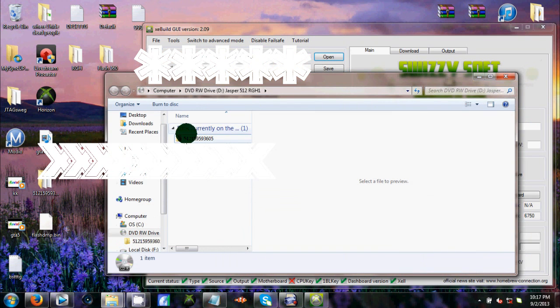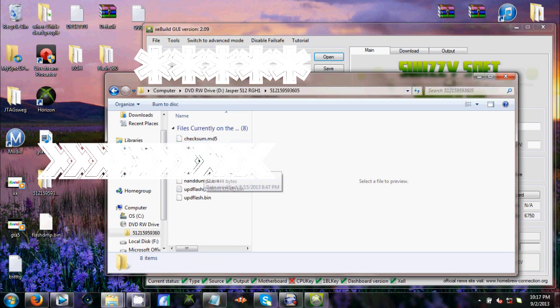If you don't have a disc for your CPU key, all you have to do is turn your RGH or JTAG off, let it sit for like two seconds, then hold down your eject button until a big blue screen pops up. It'll start loading, say 'Xell' or 'Xello,' and then it'll pop up your DVD key, CPU key, etc. It goes off your screen really fast, so I suggest you record it to play back, or take a picture.